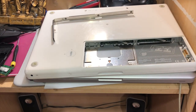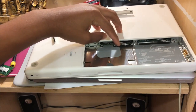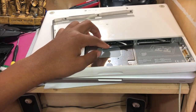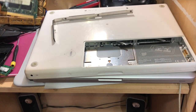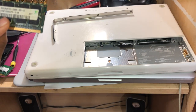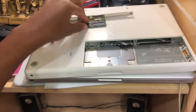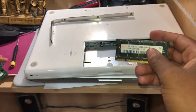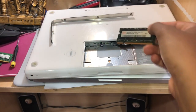Alright, so once you finally get them out, you're going to see that the RAM sticks are right there. What you're going to do is twist those little latches right there, and the RAM sticks are just going to pop out — just pull them out. There we go. These were four gigabytes total, or two gigabytes per stick. I'm actually buying another four gigabyte kit now, because I already sold this laptop to a family member — I'll tell you for how much later. There's the two gigabyte stick paired to the one gigabyte stick. Now we're going to take out the other stick of RAM.